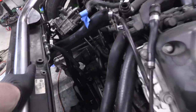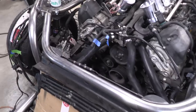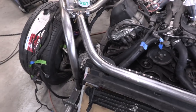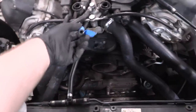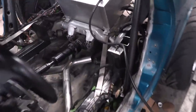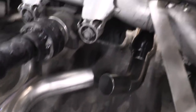Just got the fourth radiator hose installed — they're actually all installed now, clipped in, fully installed. We made it work out. It looks pretty cool, a little tentacle-y with everything running down like that. We still got room for our oil filter to be mounted around there, which is great. Now there are a couple of lines — this one and this one — that go to the reservoir, and then there's a plug here that needs to run using tubing down and around and into the back. Eric is working on getting our resonators mounted up. You can see he's got the 45s welded onto them and he's going to weld those up to the X-pipe and mount those going out the back.